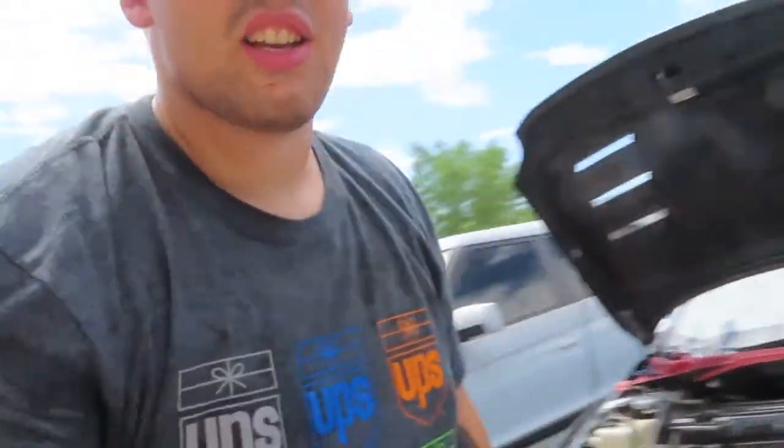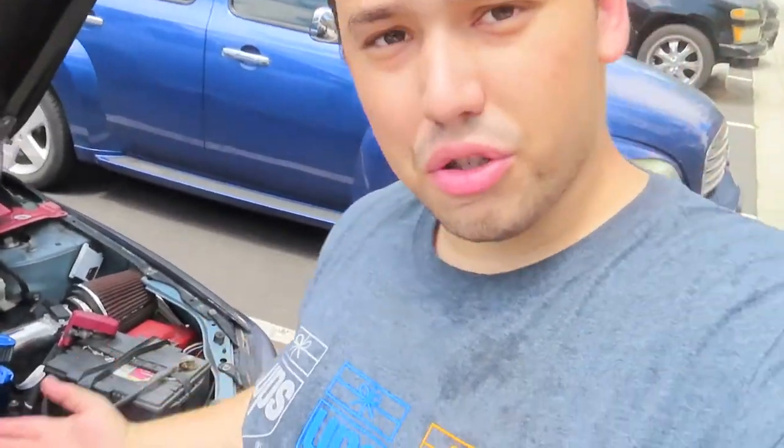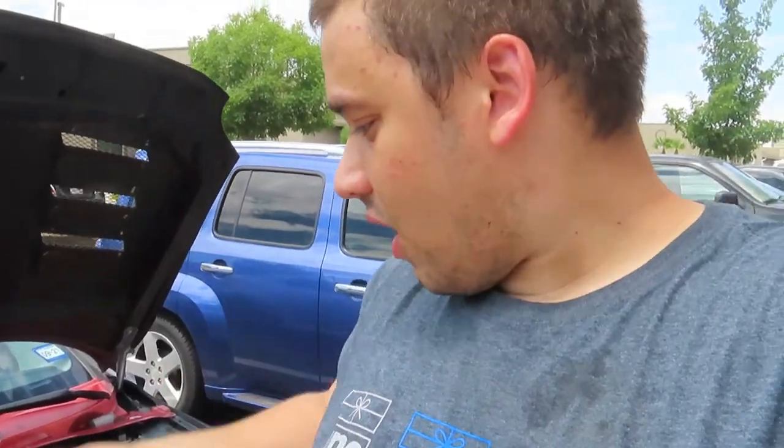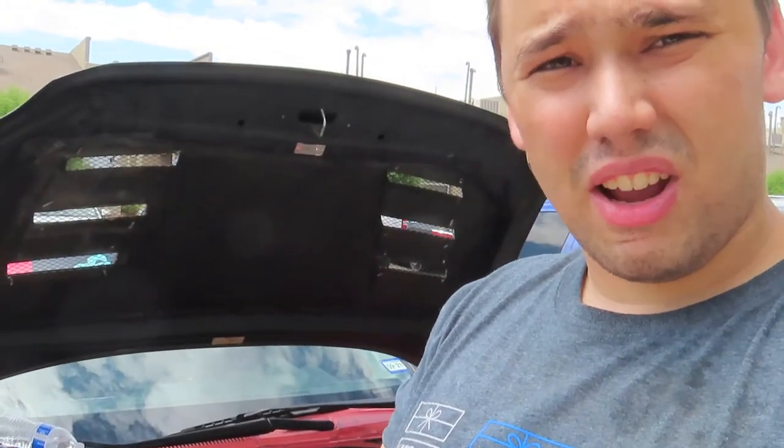Here's the other side — it's on too. However, there's something important I need to let you know before you try turning it on. On both sides I showed you where to connect the power and ground: on the driver side blue is ground and red is power, but on the passenger side blue is power and red is ground — they're switched. That's why when I first tried it one wasn't on. So make sure you pay attention to that.